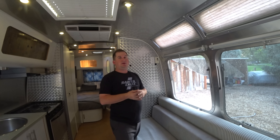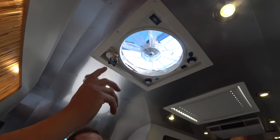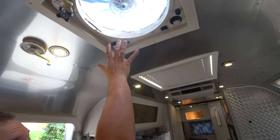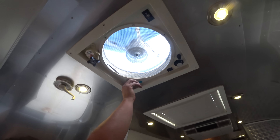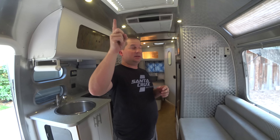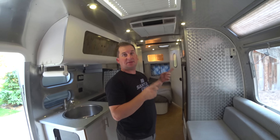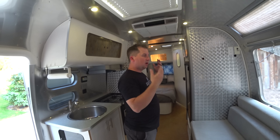In that case, when you can't get a good breeze, you want to switch to the Fantastic Fans or Max Air vents — they're all the same thing with different names — these fans right up here that evacuate hot air. This one has a built-in thermostat; when I turn it to a certain temperature it'll kick on and automatically kick off when it reaches that temperature. That's going to suck air out. The fantastic fans don't draw much power, so they do a really good job of not using your batteries up while moving air and cooling things off.